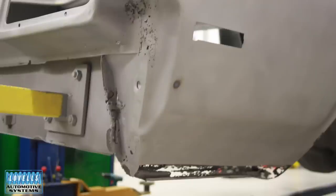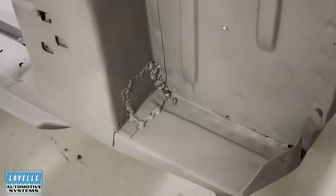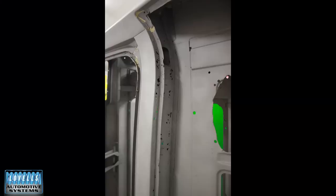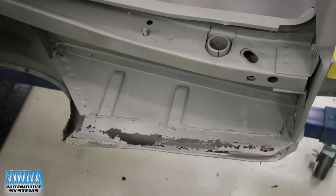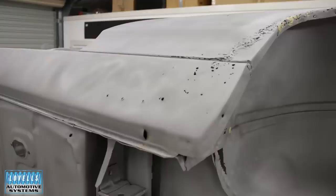The back lower quarters tend to rust on these anyway, but it was pretty bad. There's an interesting spot just under the light — that's an iron spot from the sandblasting, showing how much heat it generates. On the door pillar there's a repair, and the classic inner guard had been repaired and then the repair rusted out. There was bronze filler everywhere — nothing like a bit of bronze to do a rust repair.